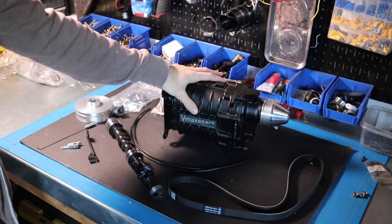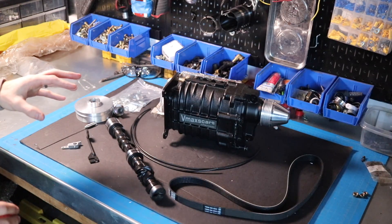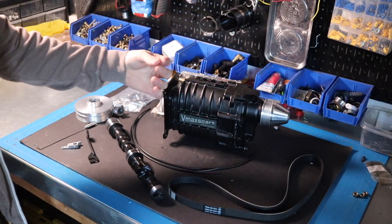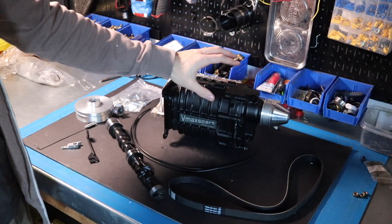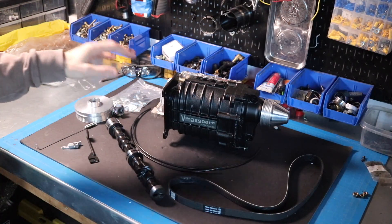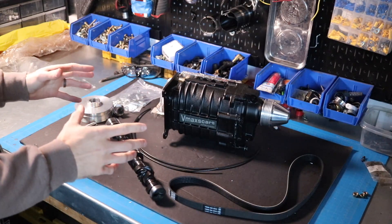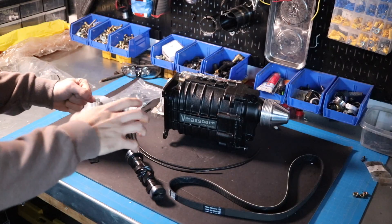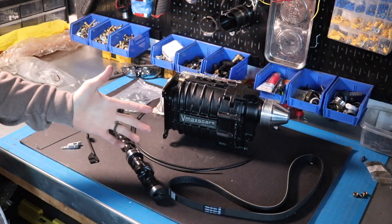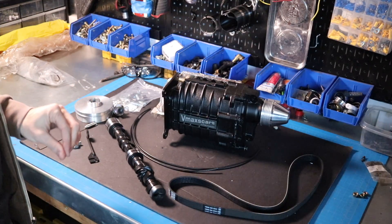A lot of you might ask why I'm using a supercharger over a turbocharger. I think both of them are awesome and either one would have been really fun. But the reason I chose a supercharger is because of the linear power delivery and the way I personally drive my mini. I want my power lower and sooner — I don't drive my car flat out at the top end basically ever. I drive it on the highway and use it to pass occasionally, but mostly I want my power low so I can get into a corner and punch it with power to pull me out. It just suits my driving style much more than a turbocharger would. The next build might be a turbo just so I can learn that process as well.